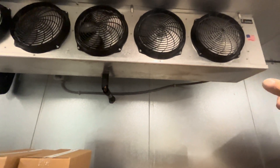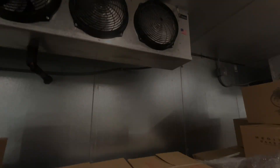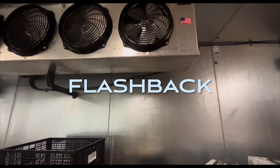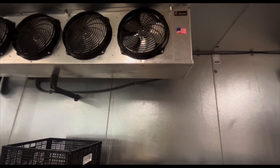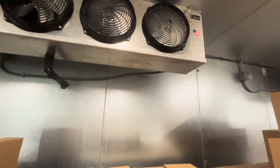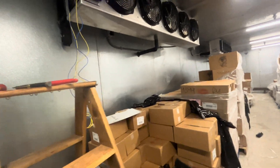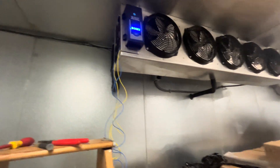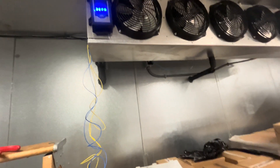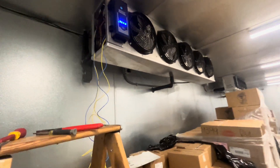Get that taken care of. But what's concerning me is that motor was what was wrong. I'll put a link in the description to the video. That fan motor stopping and spinning and going back — you'll see that it was this motor, but now it's this one. And I only got one motor. So this is Masterbuilt's idea of a cheaper way to defrost coils. It's a reverse cycle defrost, is what they call it. It's got a four-way reversing valve with a condenser, and it reverses the refrigerant flow in defrost mode.